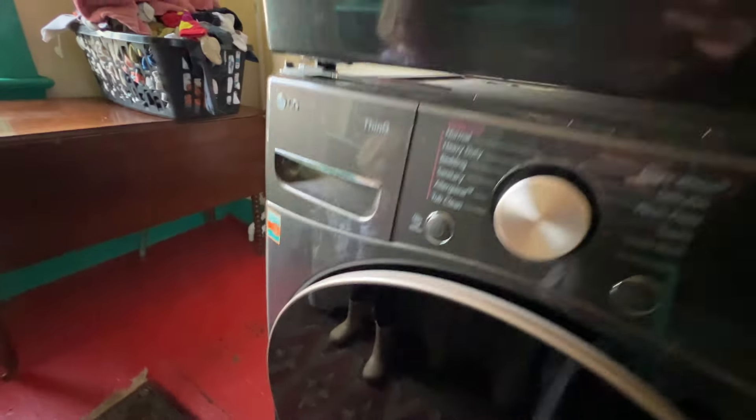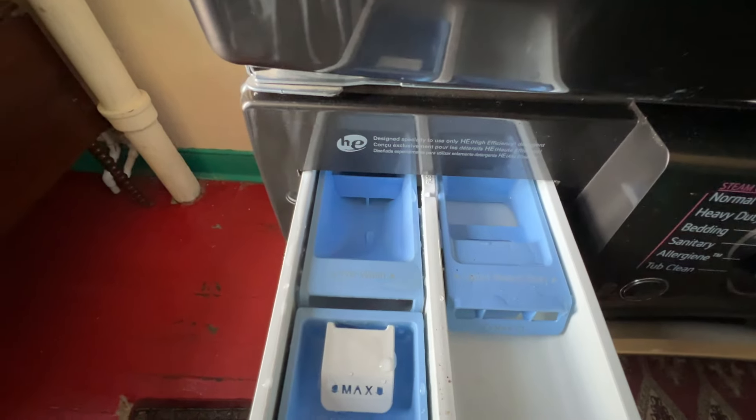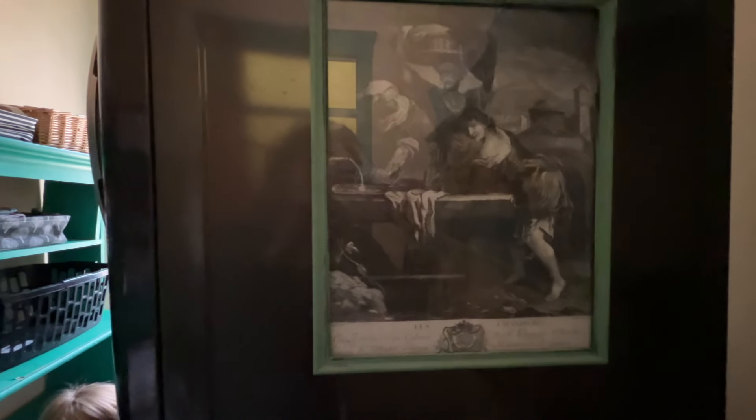I have a little cloth hanging on a hook, and every time I take a load out of the washing machine I just dry the rubber ring so it's totally dry. This is where people complain — this part gets moldy and stinky. But if you just dry it out after every wash load and then leave the washing machine door slightly ajar, it stays nice and dry and fresh. Between that and the tub clean function, my tub smells great and my clothes come out smelling great.